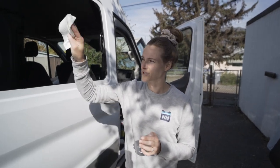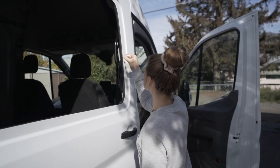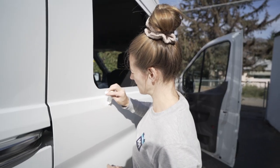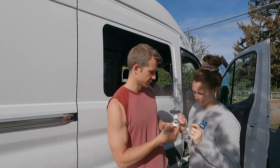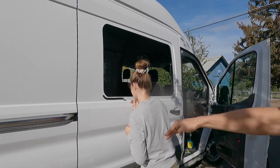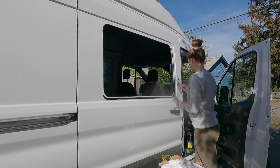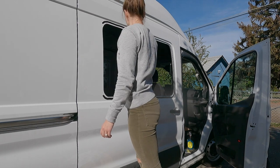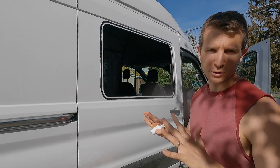We're going in with some glass cleaner to make sure the perimeter of the window is nice and clean so the primer can stick to it. Katie's using a rough sponge to rough up the paint where we're going to put the primer, then glass cleaner one more time to clean the edge. This is the primer from Van Windows Direct and we're just going to put it on with this dabber. Ideally you want to do one continuous bead, leaving half an inch from the outside. It dries pretty fast so you don't want to leave it too long, and you don't want to do too much so it runs down the side of the van — one continuous strip like that is perfect. Now we wait about 10 minutes for it to dry.